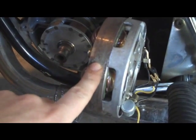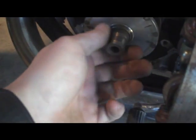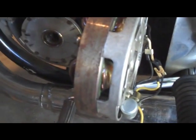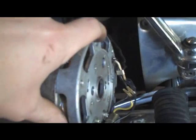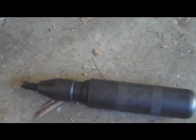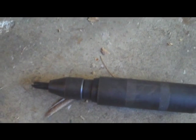The alternator casing here has to come off in order to get this breaker cam off - and there it is. Take note of the little pin on there; that pin is going to be locating it inside the shaft. So take note of that when you put the new cam in. The instructions say it's okay to put the casing back on, so that's what I'm going to do. These outer screws are real tough - I always use one of these impact tools when working on these bikes. You save the screw head and it saves you a lot of time. If you don't have one, I'd pick one up.